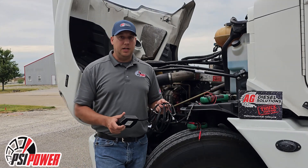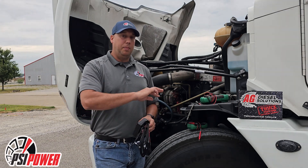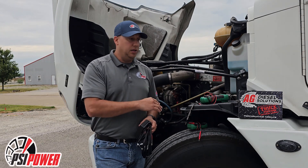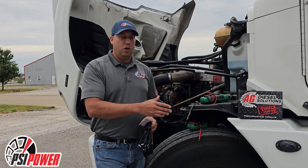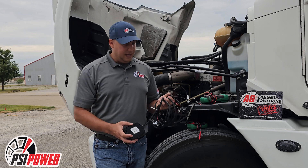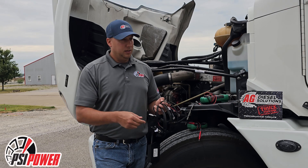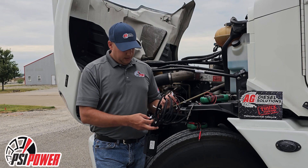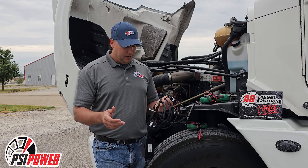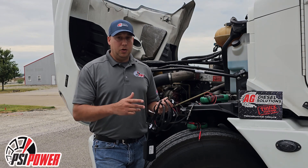On a 15,000 module, after you've found the positive side of the coils, you need to go through every coil because sometimes people will put the wires on the other side — so the positive could be on the left or the right side. In this case on this engine, five of them were positive on the left and number one cylinder was actually positive on the right. For the 15,000 part number, each terminal is labeled: pins 1, 2, 4, 5, 7, and 8 go to the positive, and pins 3 and 6 go to the negative on the corresponding coil.